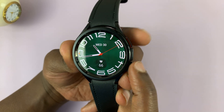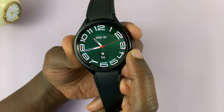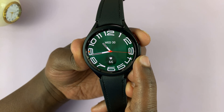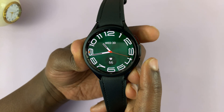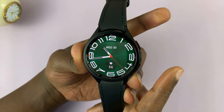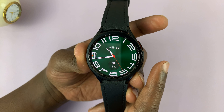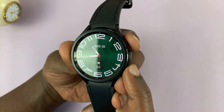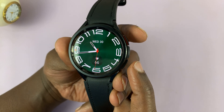What you need to do is press and hold these two buttons. And as you press and hold, eventually the watch will go off, the screen will go off. Just keep holding — don't release anything until you see the Samsung logo, and then you can release. That is going to be a forced restart. So let's try that — press and hold both buttons simultaneously.